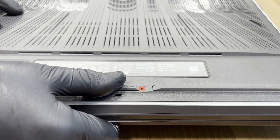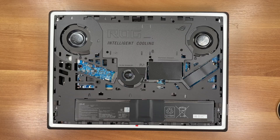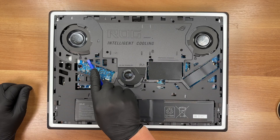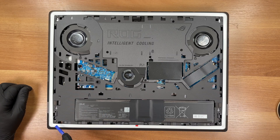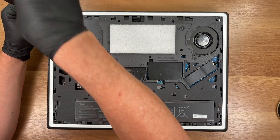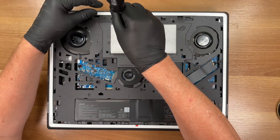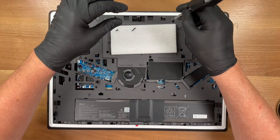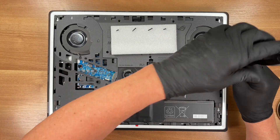Here's a slow motion close-up of the process. The inner shielding cover holds 19 screws. We'll point them out one by one before taking it off. We start with the first screw at the top left corner. It and the one in the opposite corner are shorter — M2 5.5mm. The remaining 17 screws are 10mm. We use a Japanese industrial standard number one screwdriver. Here is the second short screw.